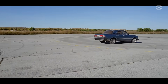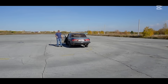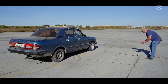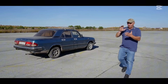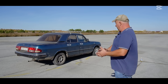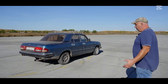Here we go — 3,000 RPM. It wasn't decelerating whatsoever. Holy cow, this cooking oil — that's an impressive stopping distance of like 20 meters. Things go very nicely on the cooking oil. When I got on the brakes, if I were to tap the brake pedal to scrub the oil off, that would have created some friction between the pads and the rotors. But for this experiment, I just slam and hold, and when I pin the pedal and keep it there, I can literally feel there is like no friction whatsoever — it just keeps on rolling. It did stop at some point, but it rolled far. Let's try a different type of oil.